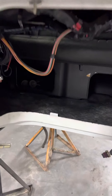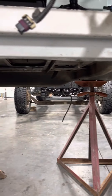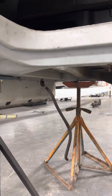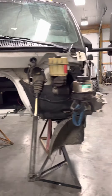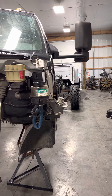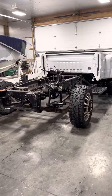The cab's in real nice shape. We're gonna get it on the cart — there's no rust on this thing anywhere. We are going to get the bottom all degreased, sanded down, and we'll spray some nice rust preventive white paint on it and put some sound deadening underneath there. It's really easy to work on when it's all apart like this.